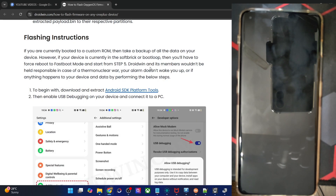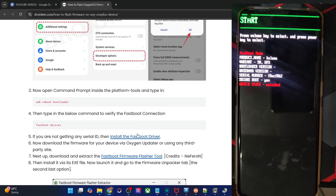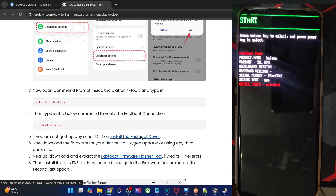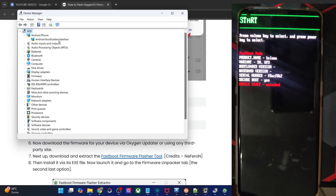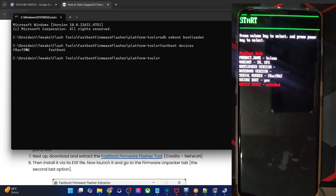Let me show you the link for the tool as well. Once you are inside fastboot mode, you could download the fastboot drivers. Type fastboot devices and verify that you are getting an ID. If you're not getting any ID, you'll have to install fastboot drivers — refer to my guide for that. Right-click the Windows icon, choose Device Manager, expand the Android Phone section, and make sure your phone is shown as Android Bootloader Interface. This, along with the serial ID next to fastboot, confirms your PC can read the phone in fastboot mode.